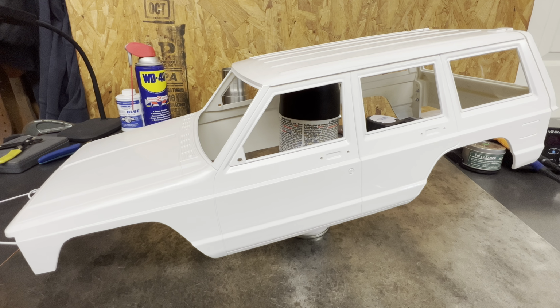Don't get it to where it's running all down the side and all that stuff. You're going to have a bunch of problems. So if you see it getting wet enough that the paint's trying to sag down, or the primer that is trying to sag, stop where you're at, let it cure for another 10 minutes, and go back for another coat.